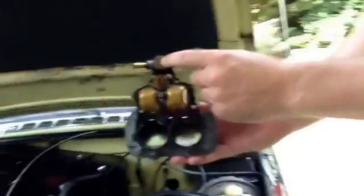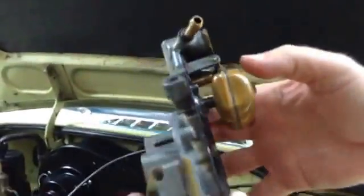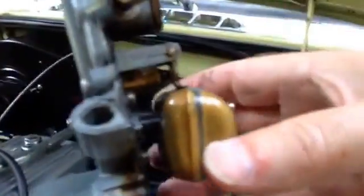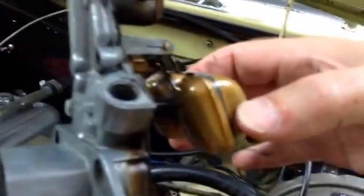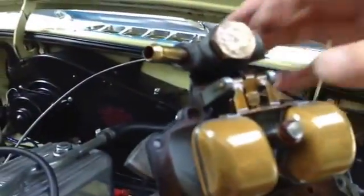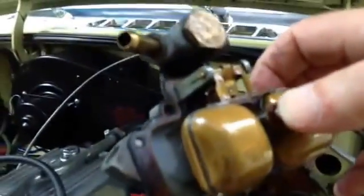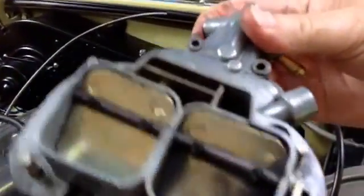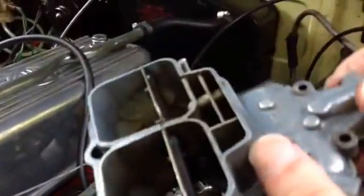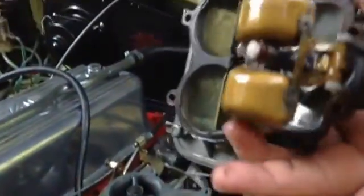Under this brass screw plug, there is a filter that filters the gas coming in. You can see there's a needle valve right there. You can also see the floats and how they work — when it needs gas, it comes down and gas comes out. There's also something called a power control valve right here — it's this plunger-looking thing. It works when you have low vacuum, and it allows more gas to come into the carburetor. This is also where the manual choke attaches. This one has a lot of wear right there — I wish they had a bushing — but it still works and closes up pretty well.